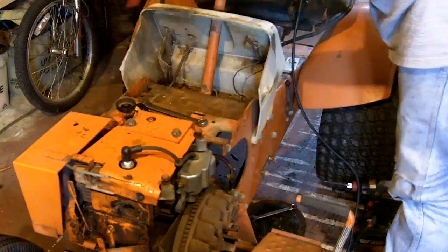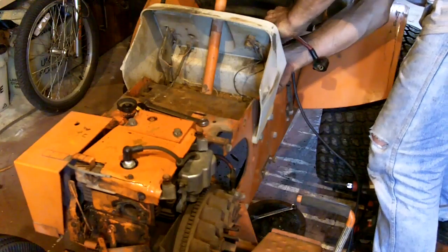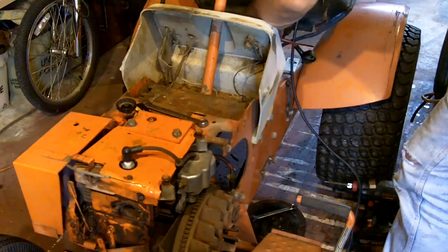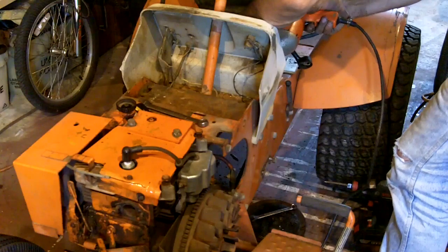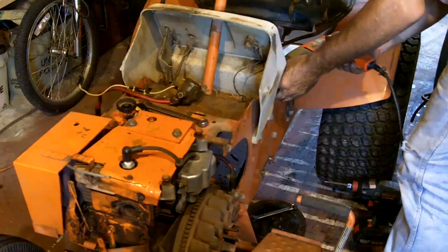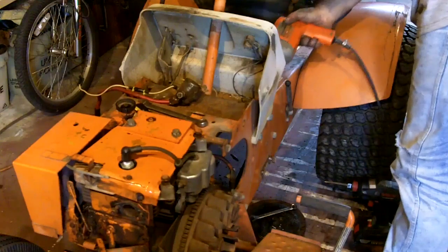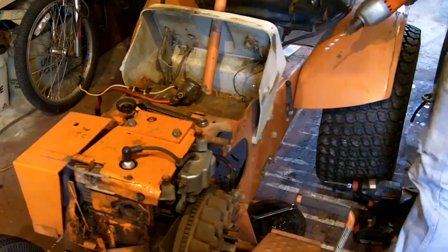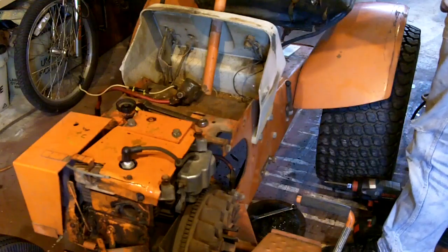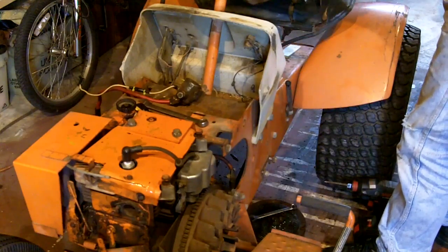Now the hard one is getting this lined up so that they both end up where they're supposed to be. Oh, the solenoid has some adjustment on it, we'll say. The holes are oval shaped. Alright. Yeah, I got my little mark there. Open that hole up just a little bit because that drill bit's just a hair small. Now we'll slip our 2 bolts in there like so, and get our nuts and lock washers.